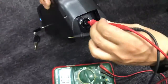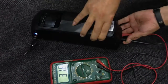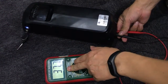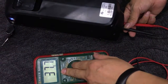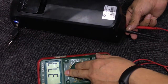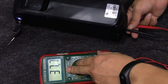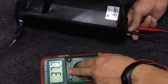Do as our staff are showing. Now you can see the voltage is 37.7V, which means this e-bike's battery has no problem. But if your test result is zero, it means your fuse wire has some problem.